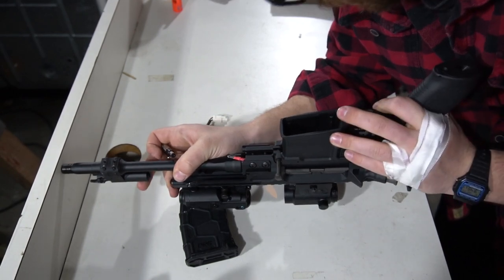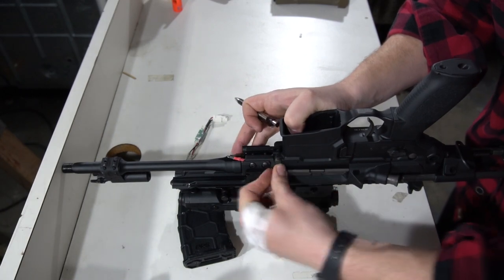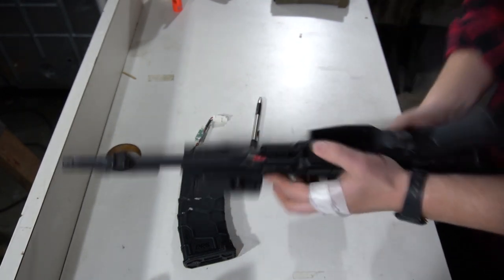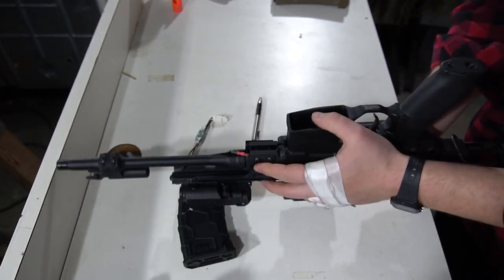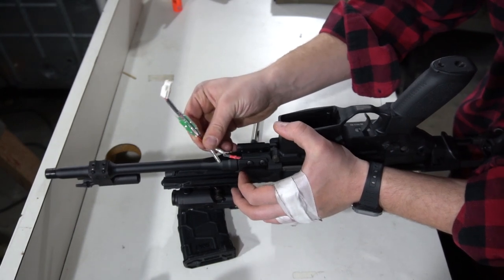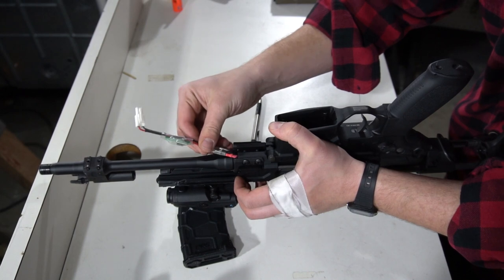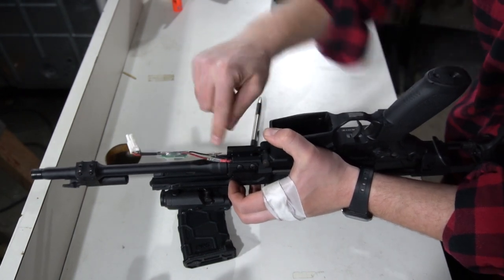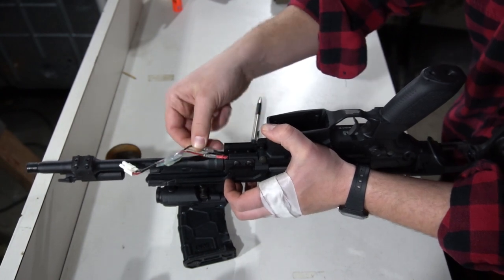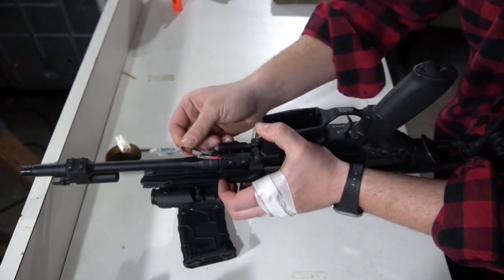Well, something popped in a fashion that I did not altogether anticipate. Okay, so your upper and lower are on. So then you have your wire connectors. It's as simple as matching colors, like in the first grade, red with red, making sure that clear sleeve is over those connectors so they can't possibly connect and short while you have the battery installed, like so.